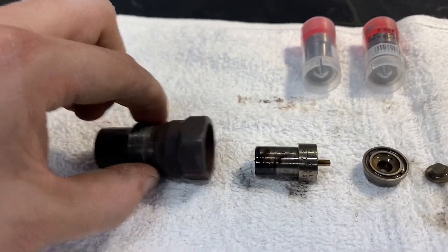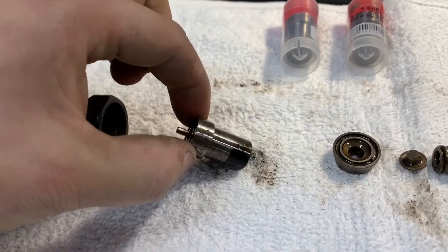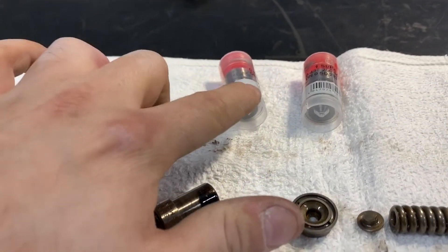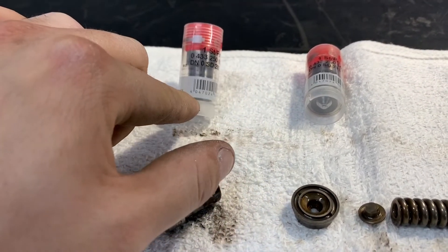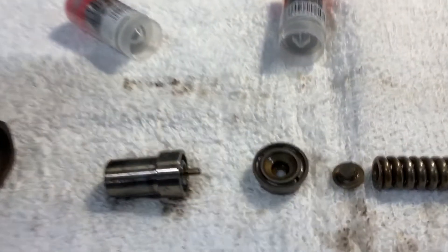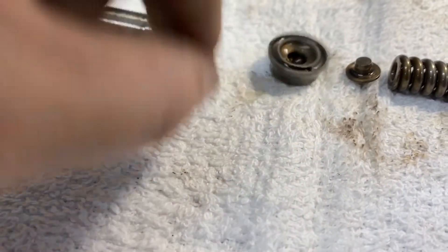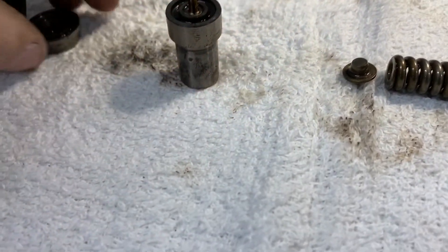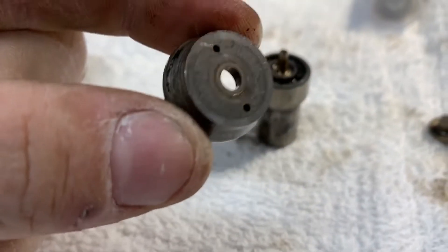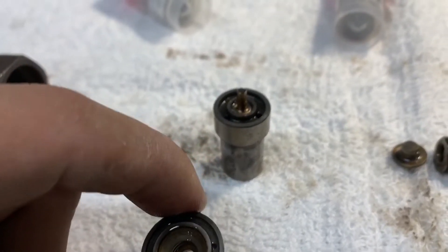Once it's apart, this comes off. You have, more or less, the nozzle here — this is what we're going to be replacing, and this is probably the only super wearable item. I have brand new Bosch diesel injectors with the exact part numbers — I'll put them in the description — and these are completely original, never touched. After the nozzle, you're going to have your nozzle seat, and the nozzle seat mates right on there. This is a metal-on-metal mating surface. There are no gaskets inside your injectors.